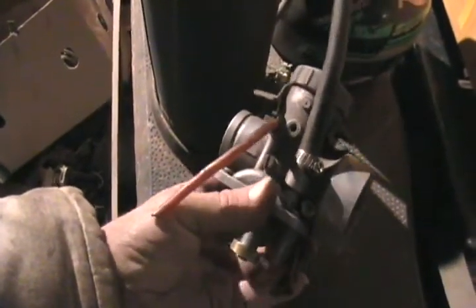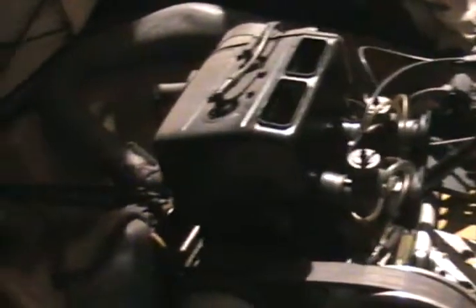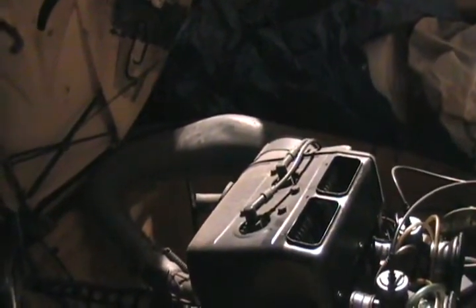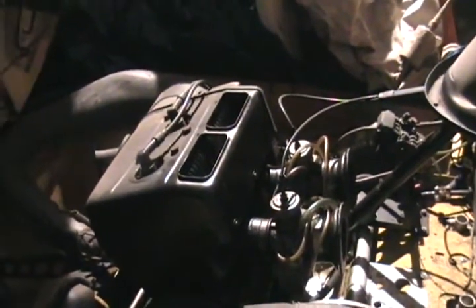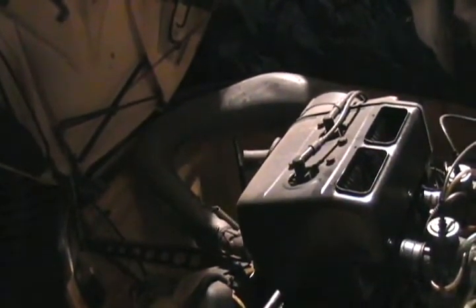In all more recent snowmobiles, they don't have two extra screws — one called H and one called L for high and low. There is no adjustment for mixture. It's all controlled by the size of those two jets. You should never have to change the mixture on your snowmobile unless you've modified the exhaust expansion chamber, removed the silencer, or put a high-flow silencer on. Your snowmobile would make more noise but then would have more power — but it wouldn't have more power until you re-jetted it, because every time you reduce back pressure on a two-stroke or a four-stroke, you have to increase the jet size a little bit. Never run a snowmobile engine or any two-stroke without an exhaust system. It'll just scream and race, lose a lot of torque, and possibly burn out your motor. It causes it to run way too lean.